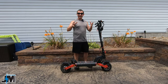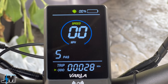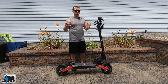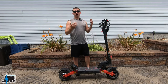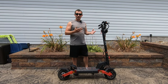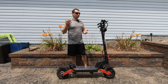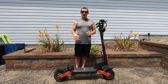Quick update from the next day: I rode this scooter until the battery got down to zero percent — it's sitting at 41.6 volts at idle. I was able to get 28 miles out of that charge, and that's with the settings turned up, riding really hard, doing max speeds, testing uphills, and everything. On average you should get at least that if you're 175 pounds like me. I might get more range after I cycle the battery a few times and let those cells balance. You may get more or less depending on your riding style and terrain.